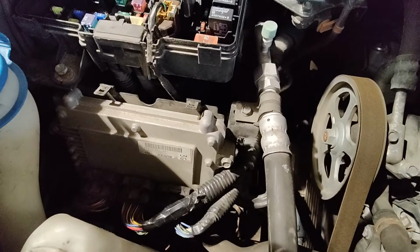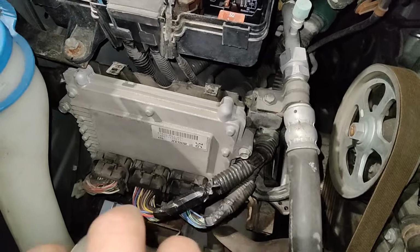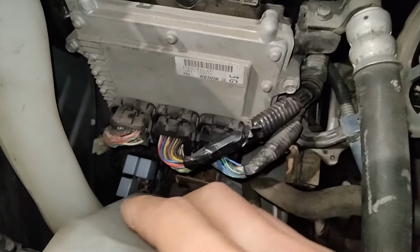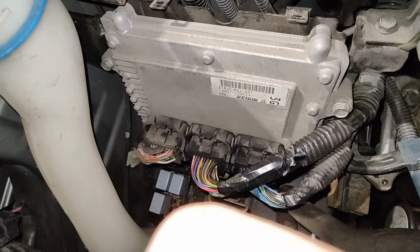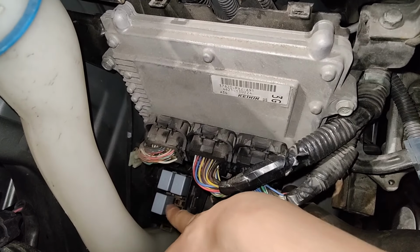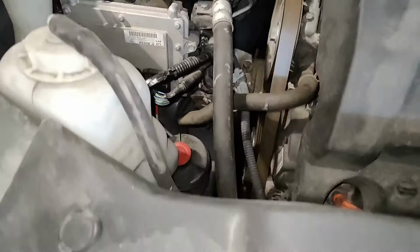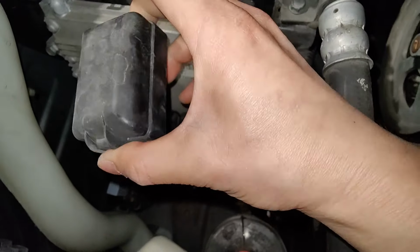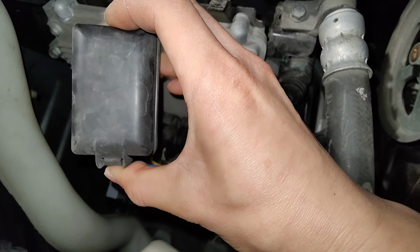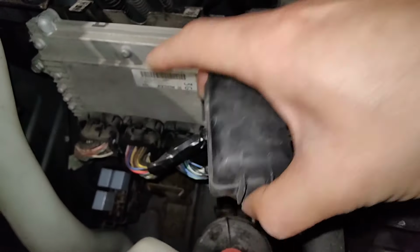So yeah, if you're looking for that intermittent wiper relay, there's a cover for this PCM that you have to remove underneath the coolant bottle, and it's right there, and it should be that bottom one right there. And there's this little cover that covers it. It's not labeled which relay it is, so just so you know. But yeah, I did check it and it does click when you turn on the wipers.